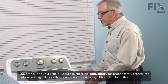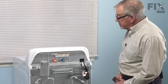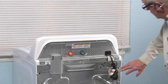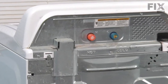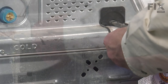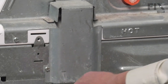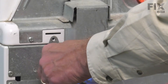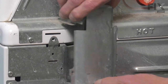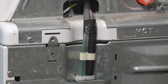Once you've done that, just pull it forward enough so we can get to the back. The repair will need to raise the main top. On this style of washer, that first involves removing a couple of screws that secure that back panel support to the main top, so we'll take those two out. We'll also need to remove this little cover, set in place with a single screw, and pivot and remove the two little tangs from the two openings, and set that aside.